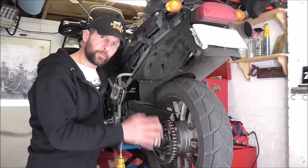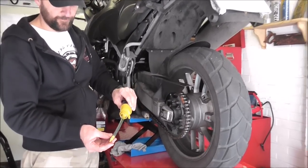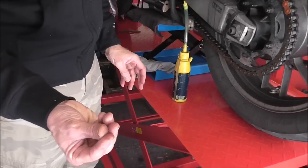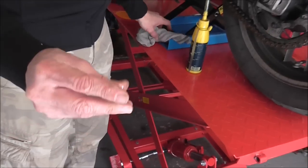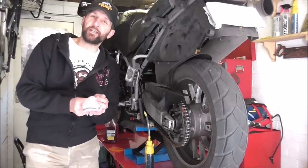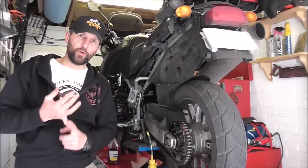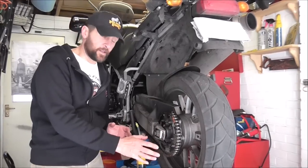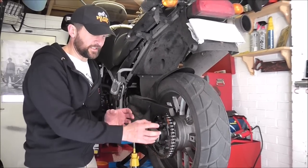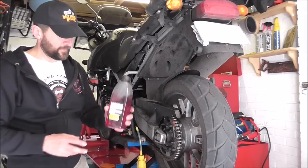When you go with the Scott Oiler it's a kind of 50/50 thing. This is the standard Scott oil I use — you can see in its properties it has this sticky, tacky quality. That's what Scott oil is like, and that's how it stays on the chain and lubricates. But personally, even that is too much for the winter. These last two months of winter there's an awful lot of salt on the roads and grit around. The chain is normally cleaner than this — that silver effect is what it normally looks like, wet all the time — but there's so much grit around now that we need to make a change.